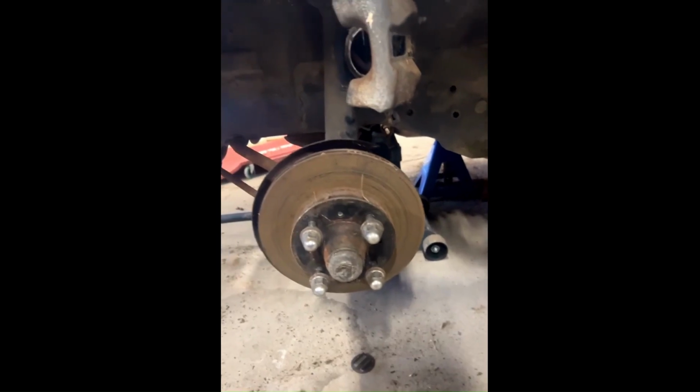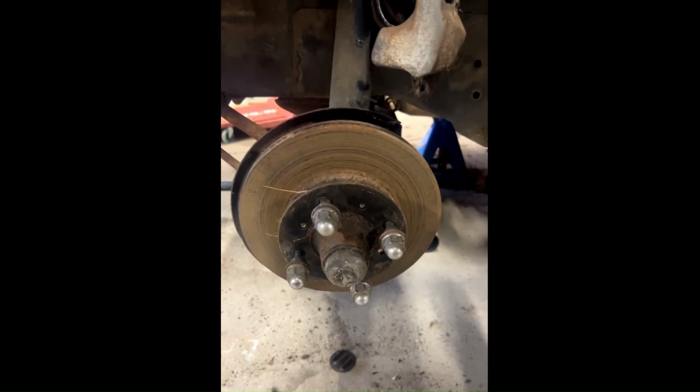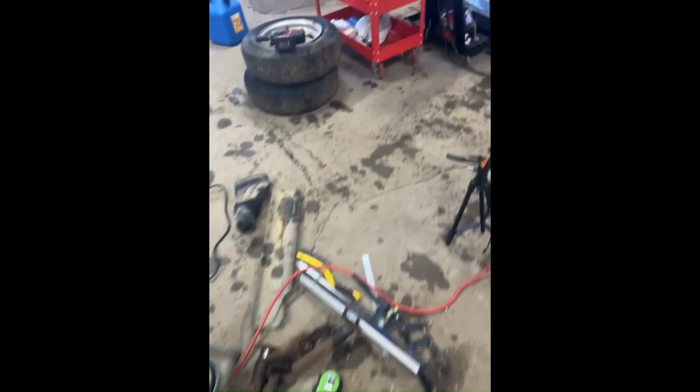My initial plan for today was to go buy a set of 4x4.5 wheels and put them on today. But then I got to thinking, I'm putting these Track Edition Brembos on, and I need to buy some rotors, and the rotors will be 5-lug, and I should just switch to 5-lug. So today, we're going to the junkyard. Slap together some tools I think I might need for this, and hit the road.